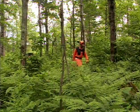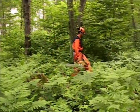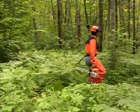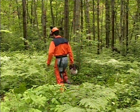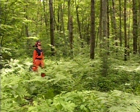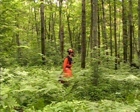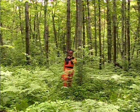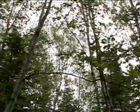When felling a tree, you will need to evaluate the dynamics of the tree, but there are also several other important details that must be considered before you choose your trees to fell. First, look in a 360-degree radius for any hazards or property that could be struck by the tree you're falling. If any of these are within reach of the tree, regardless of the direction in which you think the tree will fall, it is highly advised that you call in a professional with the proper training and equipment to fell the tree. Check the weather conditions.